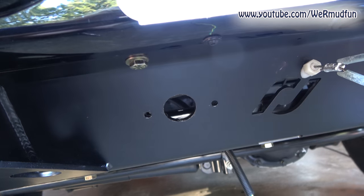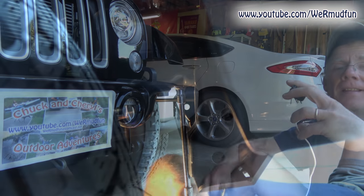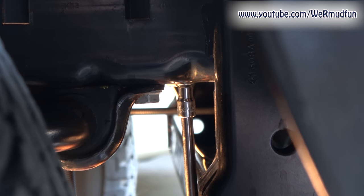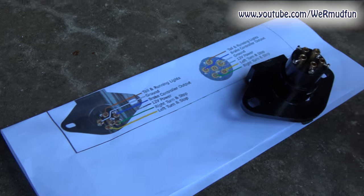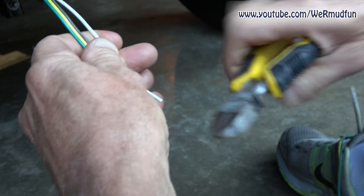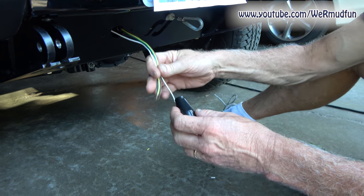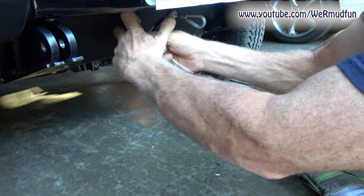We did paint to prevent rust. In case you're wondering why I didn't cut the white wire off — I was afraid I'd forget where I put it — so we're going to mount that first. We're attaching the ground wire to underneath of the Jeep. We're hooking up the tail lights, the ground, and the right and left turn and stop signals. On the six-way itself, those are the ones already unscrewed. To make sure we have enough slack, I'm cutting it to the length of what the ground wire came out to, then hook it up. And very importantly, this boot that goes on the back protects the connections — make sure the wires go through it before you hook it up, or you'll be disconnecting it again.